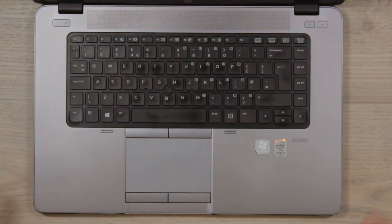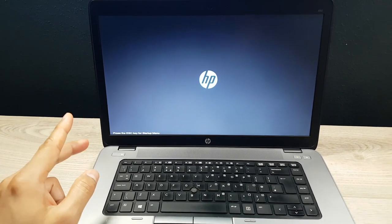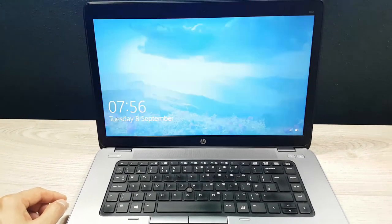Step 5: start from a cold boot. If the laptop was already on, tell the seller you want to do a cold boot — have a chat or ask for a cup of tea in the meantime. Like buying a car, a cold boot might indicate problems. If a laptop requires several boot attempts to successfully log into Windows, that could indicate a disc, RAM, motherboard, or startup issue.